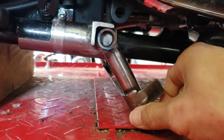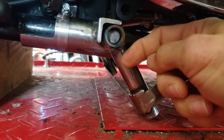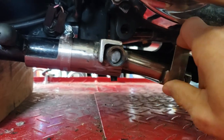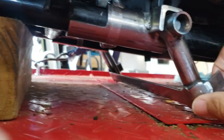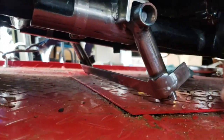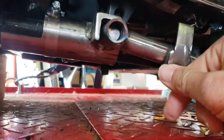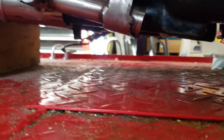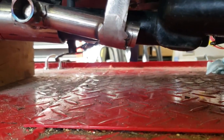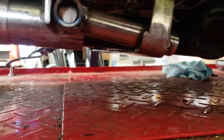I might see if I can use this as a tab for my actuator, but it's kind of low, so I think I'm going to put something up here or directly on the hinge, because that will require less movement and less length for the actuator. I used flat bar — this is a one inch — and I did it nice and low so that when it's retracted all the way up, it sits virtually flush with the bottom of the frame, which is more of what I was looking for. Using the pipe or tube, it sat down a little farther than I wanted. And it doesn't even stick down farther than the overflow hose there. Very cool.